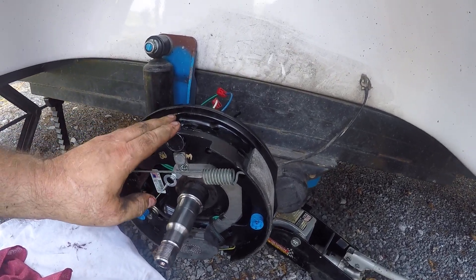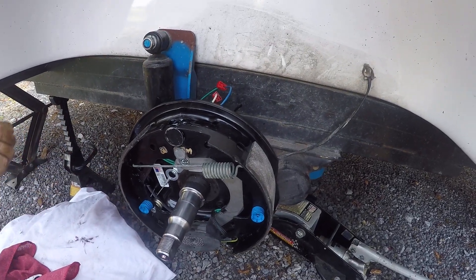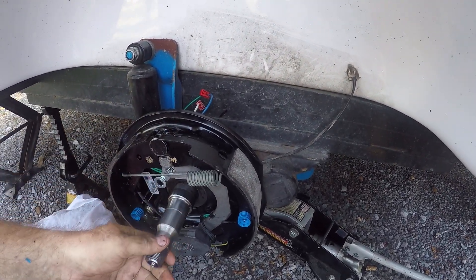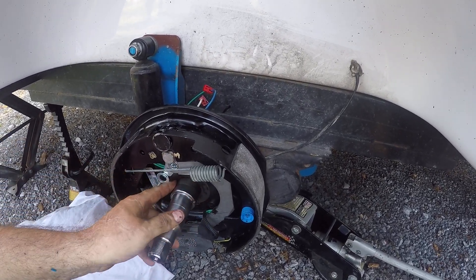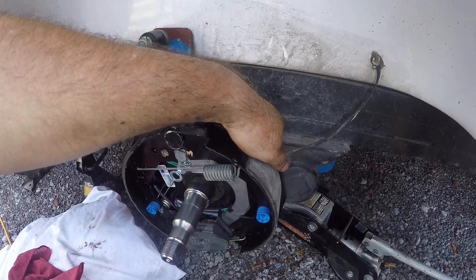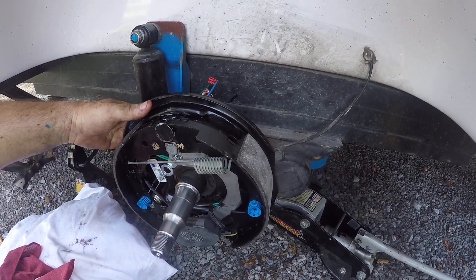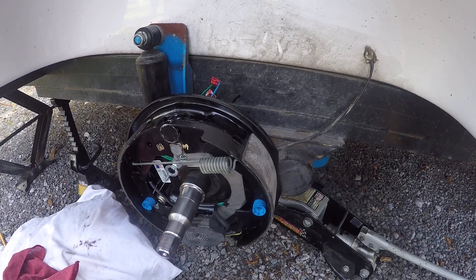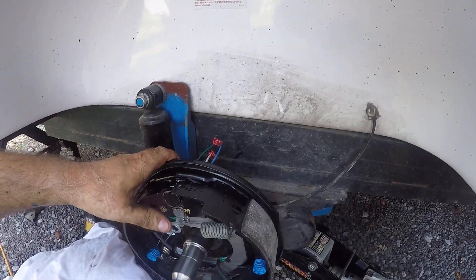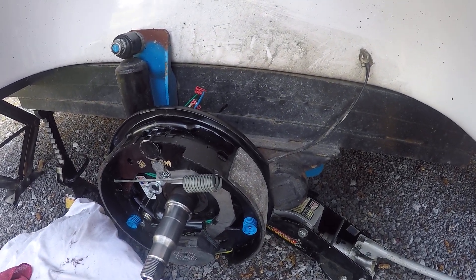This is the right side — the passenger side. You can see the short bonded brake here and the longer one on the back going toward the rear, the magnet at the bottom, wiring at the top. I cleaned this all up earlier and attached four new grade 8 bolts on the back. I use grade 8 on pretty much everything — it's pennies more but gives a lot more security. On my Casita I have shocks attached, so the back plate of those shocks is already tightened down. Now I'm ready to put the hub on.